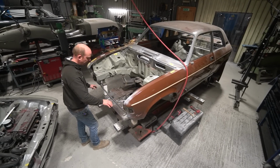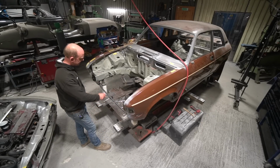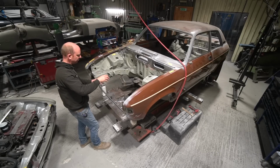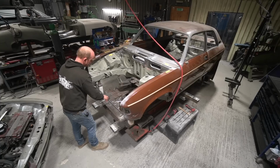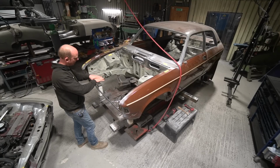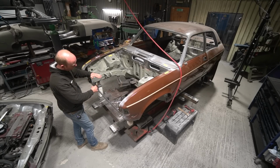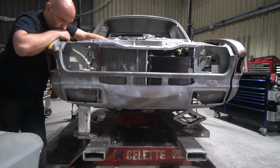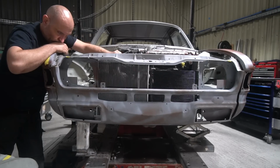It's just attached to the tube, and so then the tube will have the brackets for the radiator and the AC condenser, and also a stay bar that goes up probably between them or next to one of them. It was a bit of jiggling around to make it actually fit, but basically there'll be a stay bar going down to this, which also steadies the bonnet latch point of the slam panel, because there's a little pressed panel in the middle of there normally behind the front grille, and we've got to get rid of that because that panel's too deep. So we're going to put a stay down that carries that front panel and steadies that. So yeah, all that's to be done.